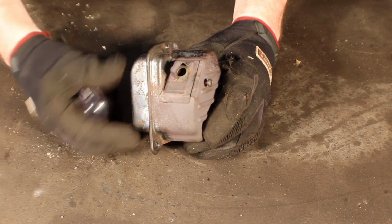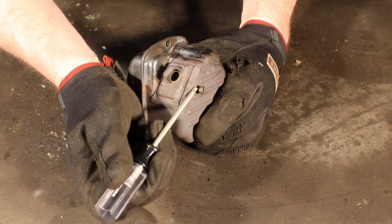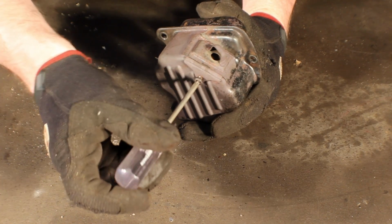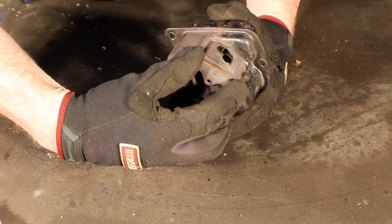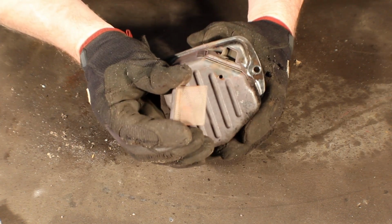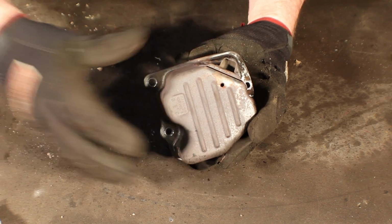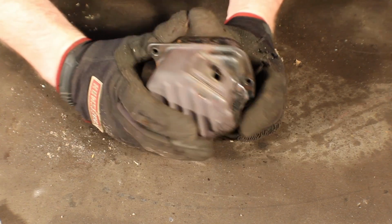So here's the muffler. Right in here you have your spark arrestor screen. In some situations by law it is required, but honestly most of my equipment I usually just take it out. Just this Torx head. It slides right on out. If you're losing power in your machines, that's often something that can be the culprit. This can get clogged up with unburnt oil. You can take those out, burn them with a torch, and give them a blast of air. When they get really hot, it'll clean right up.